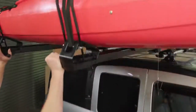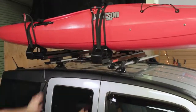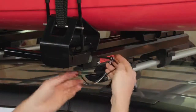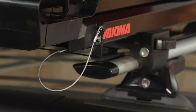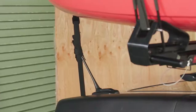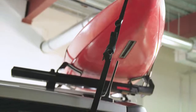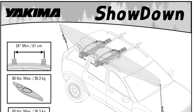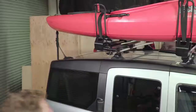Take the handles and raise the boat all the way up, then slide it onto your vehicle. Replace the safety pins — never, ever drive without those pins in place. Now use the provided straps to secure the bow and stern of the boat. Don't slack on the straps; bow and stern tie-down lines need to be used. Review your printed instructions for details on the various ways to secure your bow and stern lines.